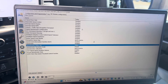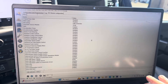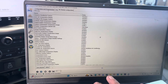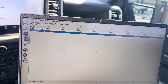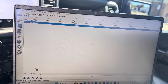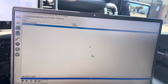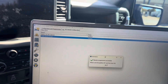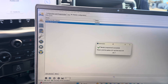Now that we have our speedo done, the next one we're going to do — we're going to stay in the IPC menu and search for turbo boost gauge. It's currently disabled, so we're going to enable it. Hit right, then key off and key back on, and then select okay.